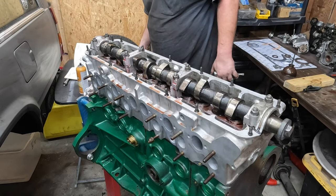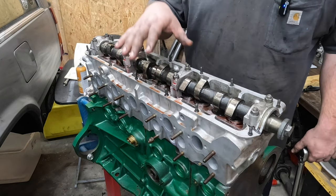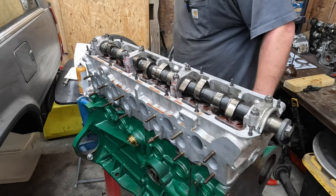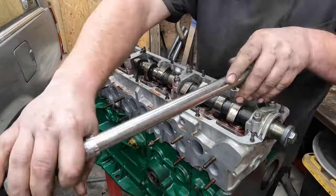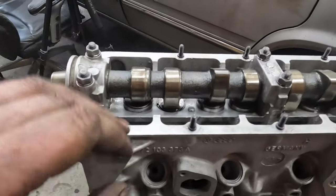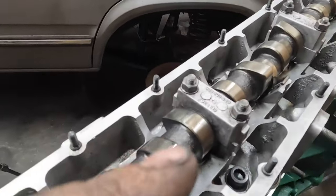In my OEM manual I have three steps: 40, 60, then 75 Newton meters. In foot-pounds that's 29, 44, then 55. Then when the engine is warmed up at operating temperature, you come back and crank them down another 90 degrees. So that's four steps total: those three, then 180 degrees, then warm it up and then 90. The head is very nearly permanently installed. With these engines you have to run them up to temperature and then give each head bolt another 90 degrees in that same sequence. So when I put the cam cover on, I'm going to leave the gaskets dry and hope they survive to reinstall later.